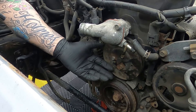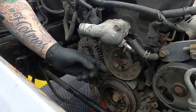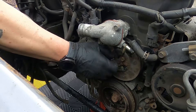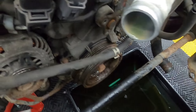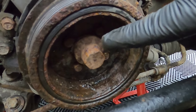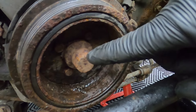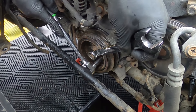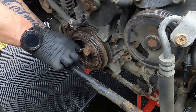Before removing the belts, just loosen these three bolts on the water pump pulley. You want to do this before removing the belts — if not the pulley will just spin. Just crack them loose, don't fully remove them. For full instructions on how to remove the auxiliary belts, go check out my video on the auxiliary belt replacement. Once you've loosened the bolts off before taking the belts off, you can then take these bolts out and remove the water pump pulley.